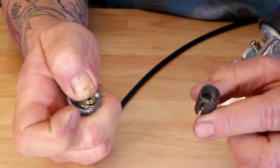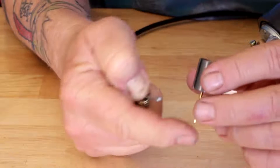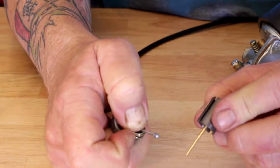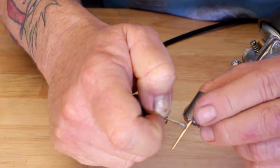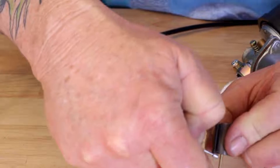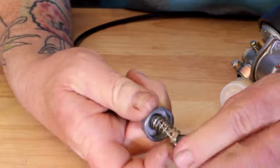Here's where your dexterity comes in. You've got the spring on the carburetor cap and the cable pushed through. Our job is to fish this into the bottom of the groove — the bottom of the groove has a special little hole drilled in to accept the barrel, or the end piece, of the cable.